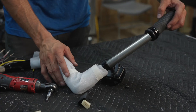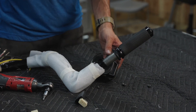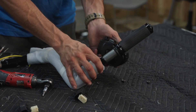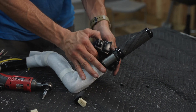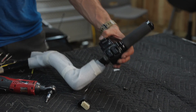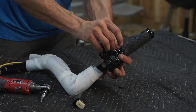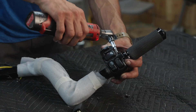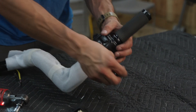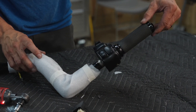These are Avon grips, which we sell online. They are keyed so they key into the switch housing. If it's a stock grip you're putting back on, you'll need to get it off your stock bar since it's glued on, and then re-glue it to your new bars. We like to use Avon grips — good quality product, comes with a limited lifetime warranty, and they're US-made. Button up the T25 bolts and snug them down. Make sure the grip is keyed into the housing — if it's keyed correctly it'll move the whole assembly.